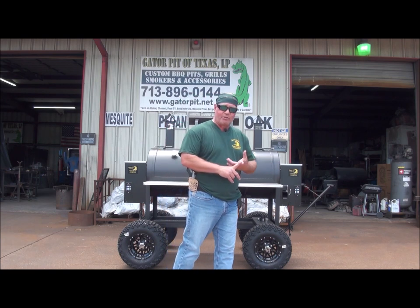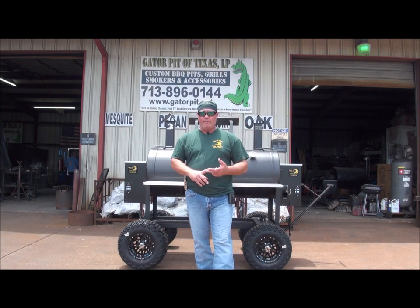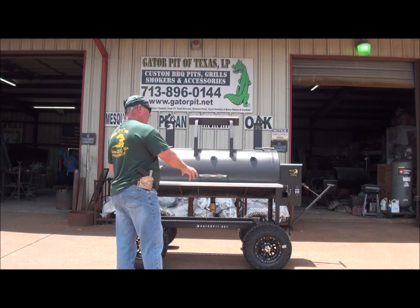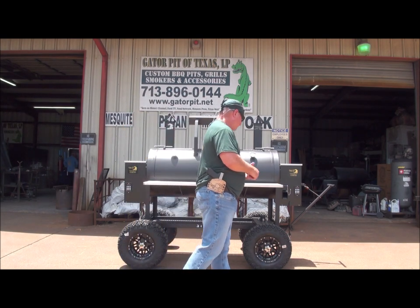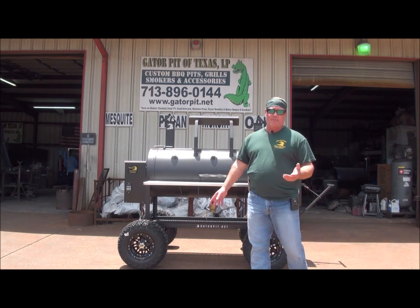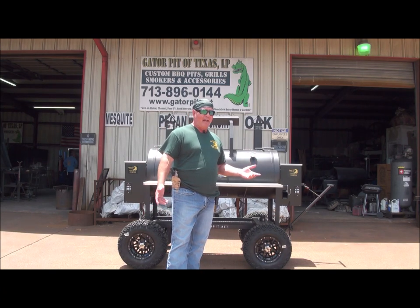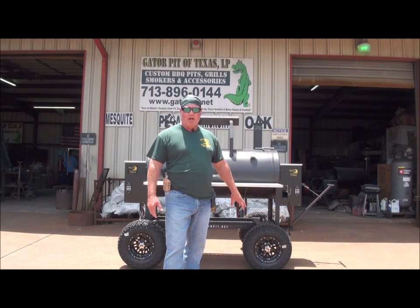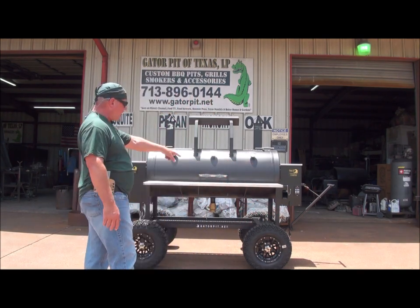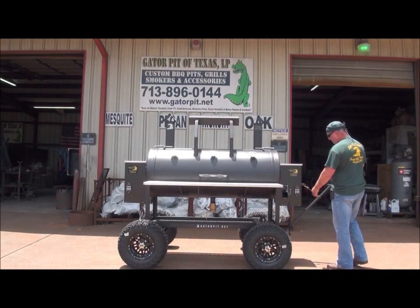The spindles are a 2K utility trailer spindle. The hubs are 2K hubs. They're four lug, half inch. And the wheels that you see are gonna be a four lug wheel. Again, everything is heavy and beefy. These hubs are actual trailer hubs that you would use on a utility trailer to haul your four wheeler or anything down the road at highway speeds. That's what your axles and hubs are. There's trailer greased bearings in there, packed. Your steering mechanism up front here is also a 2,000 pound hub.